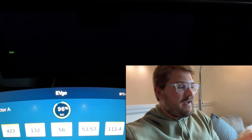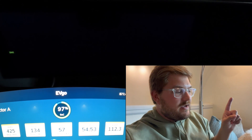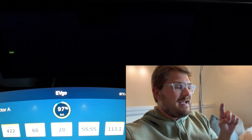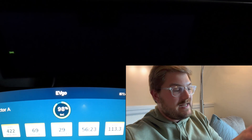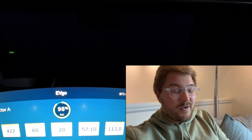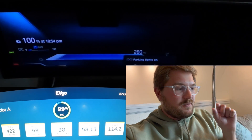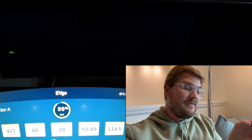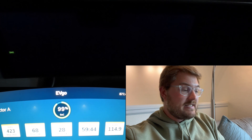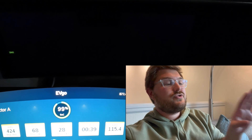We're at 95-96 percent in 54 minutes — pretty much a full charge in about an hour. The car finishes in around 1 hour 12 minutes total, but those last few percent take a really long time — we're doing 28 kW at 98 percent, just walking its way down. Overall, we delivered a lot more energy than the usable pack capacity, purely because of losses. It's a 105.6 kWh usable pack, but we delivered 114 kWh. With 400-volt architectures at high current, there are just significant losses — and it heats things up in transmission.